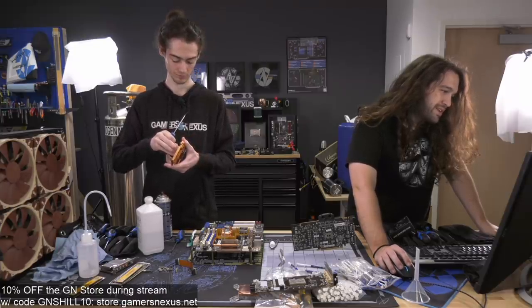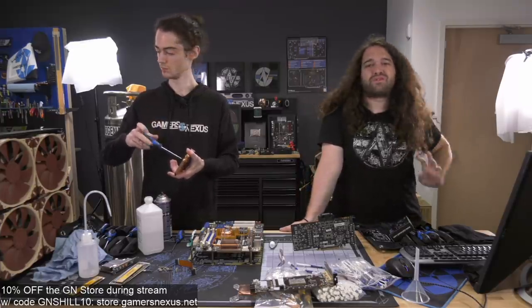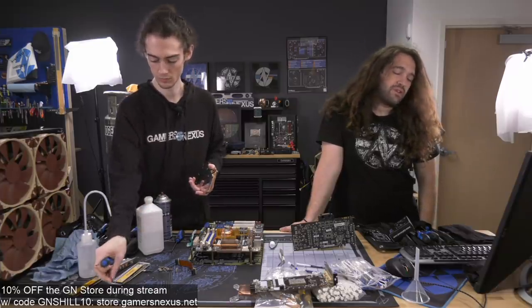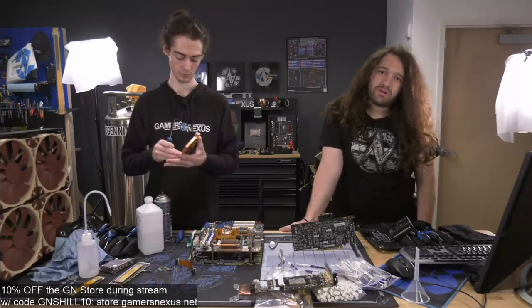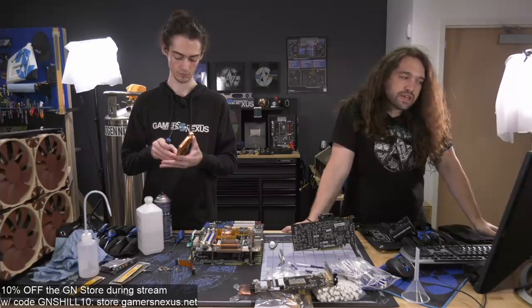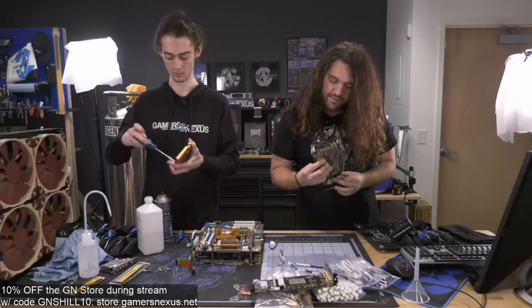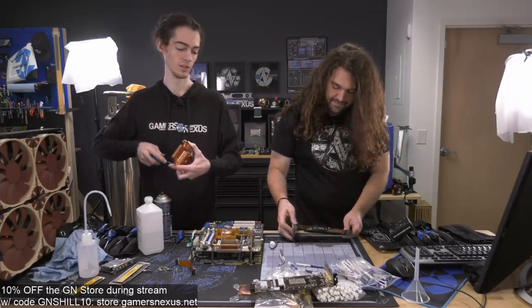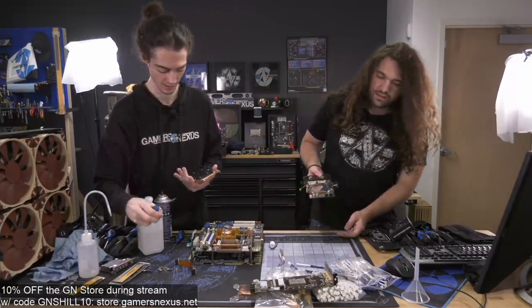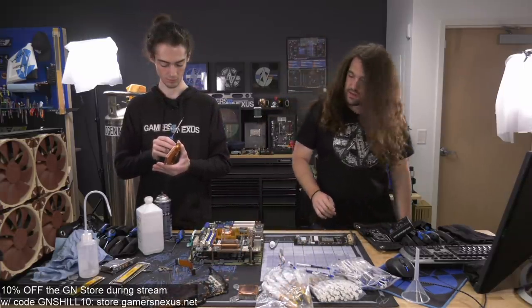Is water cooling a 2080 Ti worth it? That depends. Mostly if you want the system to look cool, or you want lower noise levels, because it's water, so you can run the fan slower and achieve the same thing or better still. So for those reasons, yes. For overclocking, you're not going to get a ton out of it, so not particularly, but definitely for the other reasons. Those coolers are typically triple slot. They're super fat now. So cutting it down to single slot is a big benefit, too. Single slot's really nice, actually.